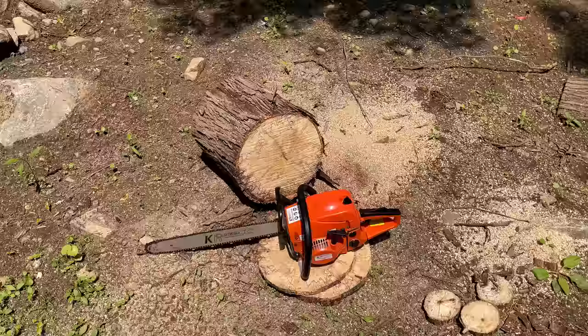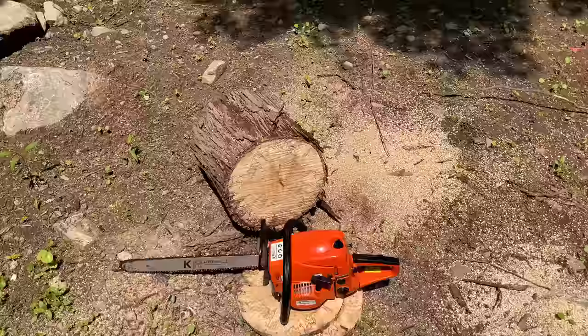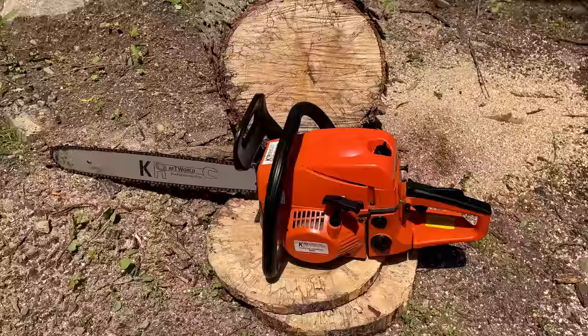I went into this assuming it was going to be a teardown video based on what the owner said about running straight fuel in this machine. And thankfully, this saw had an unbelievable amount of issues preventing it from running. We had a questionable carburetor, a clogged impulse line, cracked fuel line, and two bad crank seals.